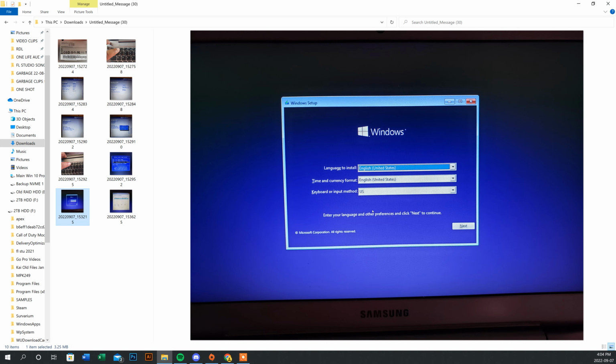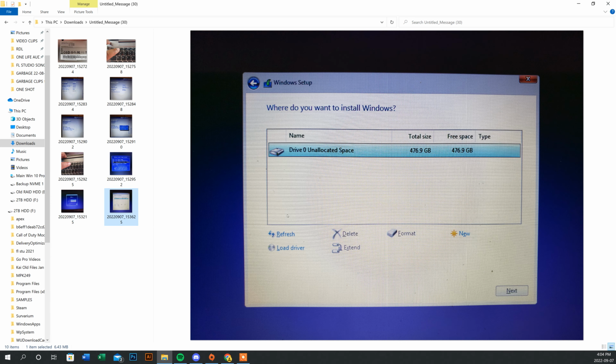And I wanted to make a quick note that if you guys have never reinstalled Windows 10, this is a very important note. As you go through the 3 or 4 or 5 transitioning stages of these screens, by pressing next, agreeing with the licenses and all the other stuff, just make note that when you choose the custom option, which is actually right before this screen here, if you are not upgrading your hard drive to an SSD, then you will most likely see a bunch of partitions here. It could be between 3 to 5 or 6 different ones, because Windows 10 will actually create a bunch of rescue partitions and other stuff.